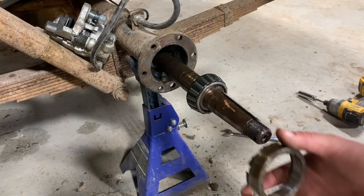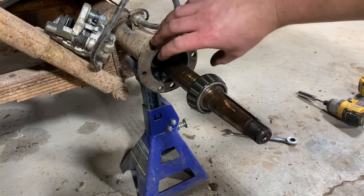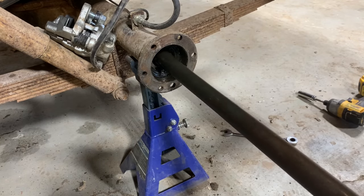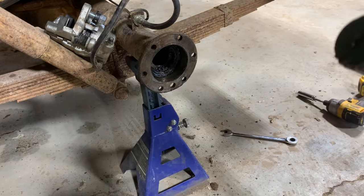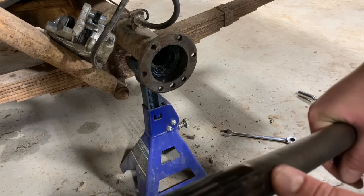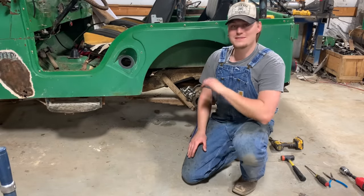What you're really pulling out is this bearing cup right here — so maybe this makes a little more sense now. This drives in right here, and other than the outer retaining stuff and the shim, this is what your axle kind of pushes up against to hold it in there. Here is our driver side axle shaft — everything looks pretty good on it. You can look straight down and if the splines are offset all around, people have about twisted them off. Everything looks good with this one though. Axle shaft is out, and everything I did on this side I'll do the exact same thing on the other side.